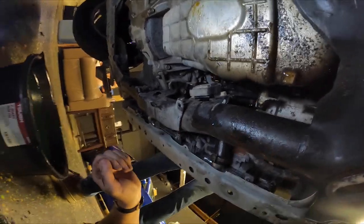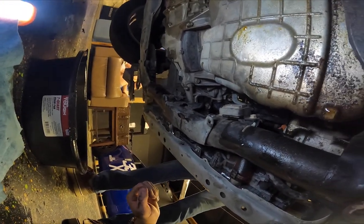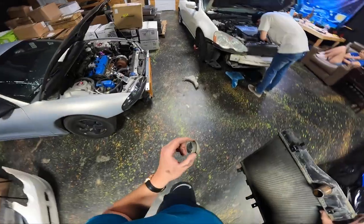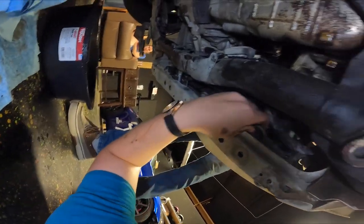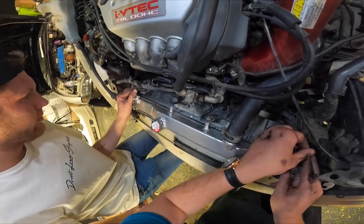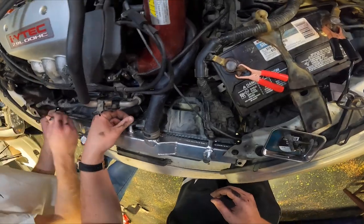Thanks. Damn it. I forgot to put the coolant temp sensor in the radiator. I also found out something. This goes underneath the radiator. So hold on, what does? These little things on the bottom. I'm gonna just go underneath like I have been doing and keep putting on things that I'm discovering we forget. And you pick it up as high as you can. Oh yeah, perfect. That's all I need. The fan shroud is definitely not up against the radiator like it's supposed to be. So we'll have to just keep an eye on coolant temps, make sure it doesn't overheat.